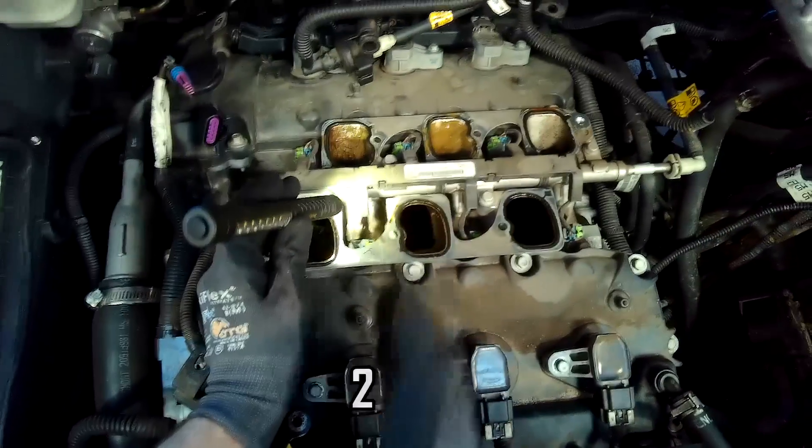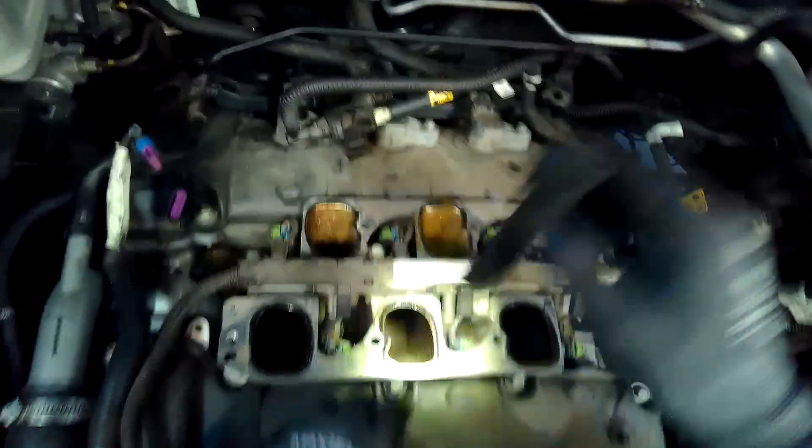As you're facing down, numbers two, four and six are facing you. As a guide for a V6, cylinder number one will be slightly more forward than cylinder two. Looking at this image you can see one is further forward, two is a little bit further back, and then they correspond three, four, five and six in that order. Once I had that information, I decided to get in and visibly inspect the top side of the engine - get that rocker cover out of the way, have a visual look at the chain and see if there are any issues.